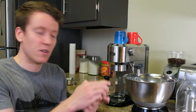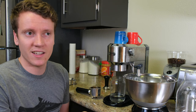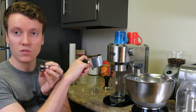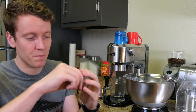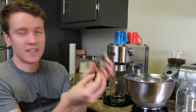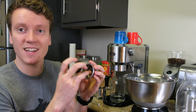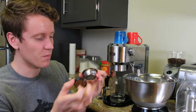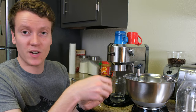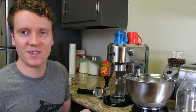I also want to cover cleaning the cups, since this is a great time to do it while you're descaling — for me it follows the same roughly six-month schedule. Take the handle, remove the cup. Inside there's a little rubber gasket with a handle — pull that handle out. Take it under hot water with a brush and brush out all the little holes. If any holes are clogged, use a toothpick or a tiny needle to make sure each hole is fully open with no coffee grounds stuck in it.